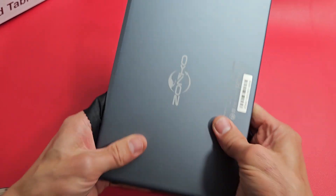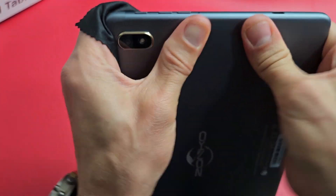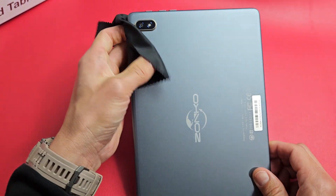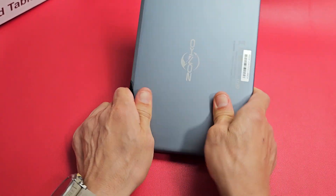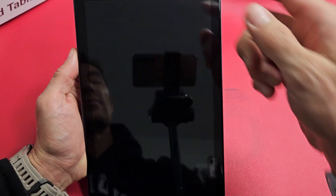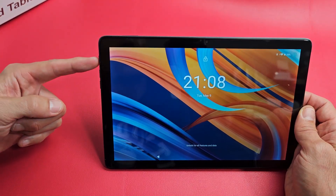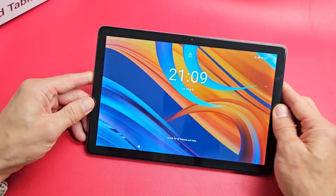If it's still black, turn it over and do the same thing to the backside. Press all over, press all around the camera lens. If you hear a click, turn it over and tap that power button. Continue to press kind of hard all over. Turn it over, tap that power button, and see if your screen comes on. If not, force restart — press and hold the power button, do not let go until you see the Zonko logo, then let go. Hopefully you are now out of the black screen.